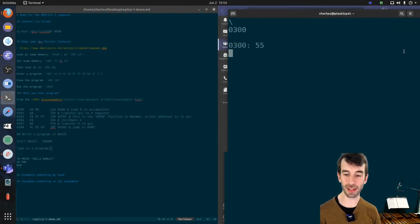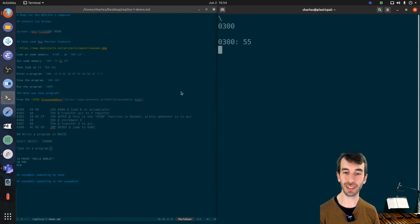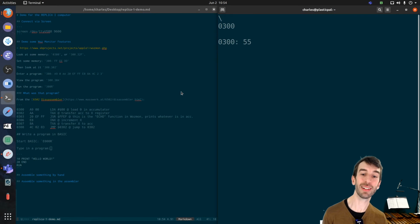I'll wait and see if there's any final question, but I'll show you how to get into BASIC. We need to know where the BASIC interpreter is located in memory, which is E000, and then we need to run that. So type E000R. Okay, now we're in BASIC, and we've got a prompt actually. So we can start looking at writing a BASIC program.